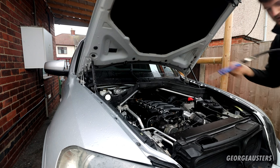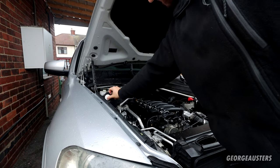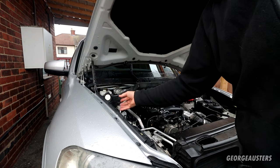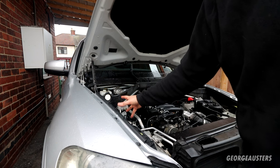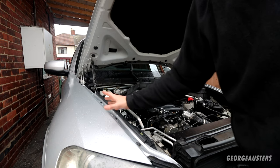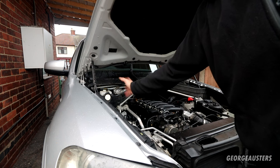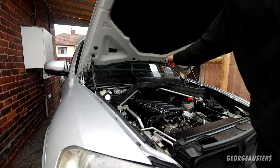It's not so much now, but the first few times I did this, there was so much debris and dirt just coming out of here. That is obviously what blocks up the washer pump filters themselves — that is what you're trying to clean, because if those filters are completely blocked, you're not going to get any fluid through. In my opinion, if you want to clean those filters without having to go through all the trouble of stripping pretty much half of the car down, this is the best way: just remove the hose off of the washer jet, blow through with compressed air, and then keep refilling with regular water, repeating the process until you're getting nice clean fluid to the washer jets themselves.